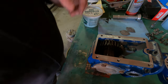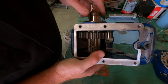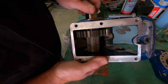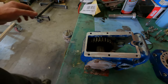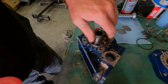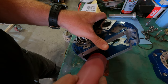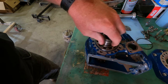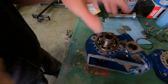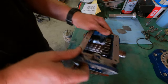I'm going to show you guys how this thing goes back together. There's nothing wrong with the bearings, there's nothing wrong with the output shaft here, so I'm not going to take it apart. However, it has gone through the parts washer - it is clean and the bearings are dry. So what I'm going to do is just put a little spot of automatic transmission fluid on that bearing so it doesn't start dry. We'll do the same on the other side before we put the cover on. So that bearing's been lubed, now we'll flip this guy around.